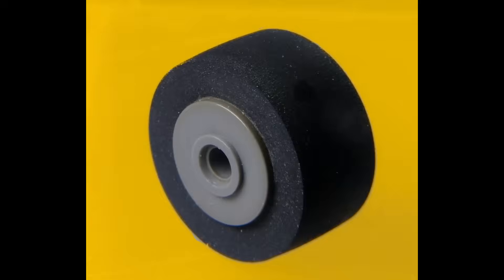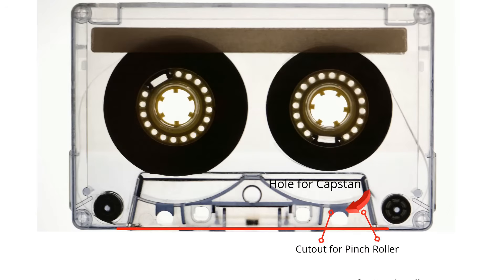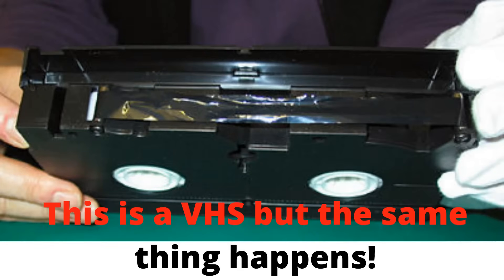It looks like such a simple little thing, but let's get into it. Why do we need a pinch roller? What do they do? And why do they give us so much trouble? I'm going to use cassettes for the example, but it's applicable to 8-tracks and reel-to-reel. If you look on this cassette, where the red line is, is where the tape would normally be running. But with the heads put in, the tape actually goes in a different direction — in and out. That's because the heads are pushed forward when you push the play button, and the tape has to go round them to give good contact and proper playback. And when things go wrong, this is what can happen. Every long-term cassette user will have had this happen at least once. It doesn't only happen to audio tapes — it can happen to VHS as well.